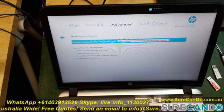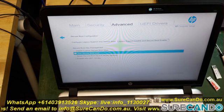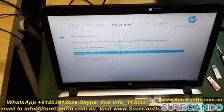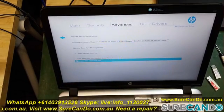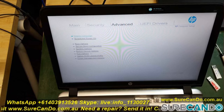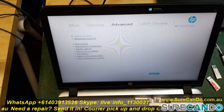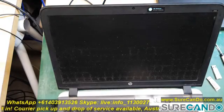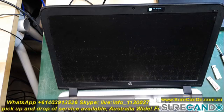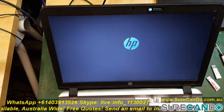There is the option to clear secure boot keys — enable that, and then when you save changes and exit, it will ask you to type in a four-digit code, which is common on HP laptops. When you disable secure boot, you need to enter that code. If you don't get that message, secure boot will never be disabled.